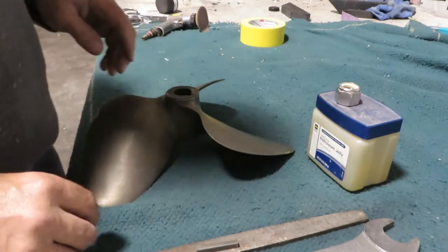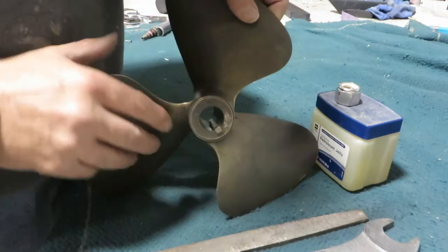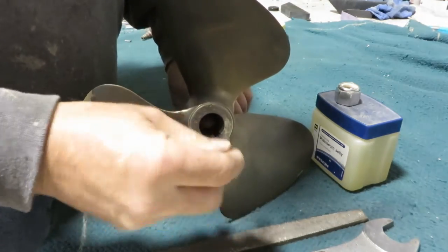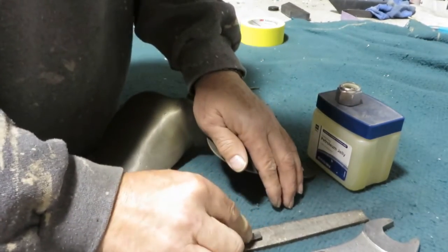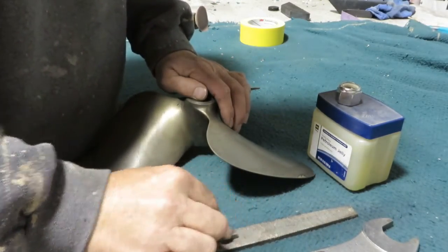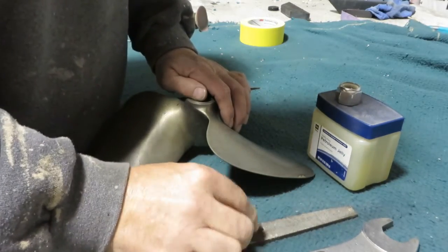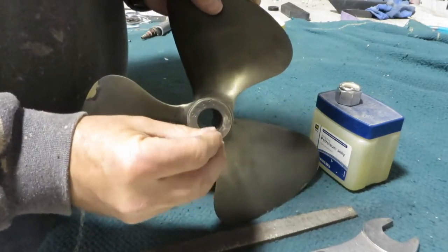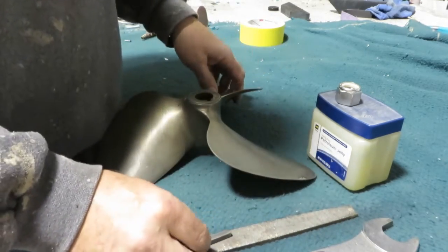The first thing we really want to do is make sure that the key slides in and out of the keyway slot on the propeller and also on the prop shaft. If there's a little burr or it's not sliding freely, which is typical, I prefer to use a hand file. Set the hand file down and then simply take the key and rub it back and forth against the file, rotating it so you get each of the four sides of the key nice and smooth and flat. Then you can take it and put it back into the prop, make sure it's sliding freely, nice and easy, no burrs — we're good to go.